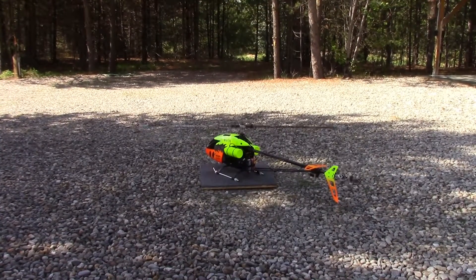I'm not going to show you the whole thing - we'll just take it off. But I've got to run this thing for a good five minutes to get that gearbox oil up to temperature, and then we'll bring it into the garage and drain her out.